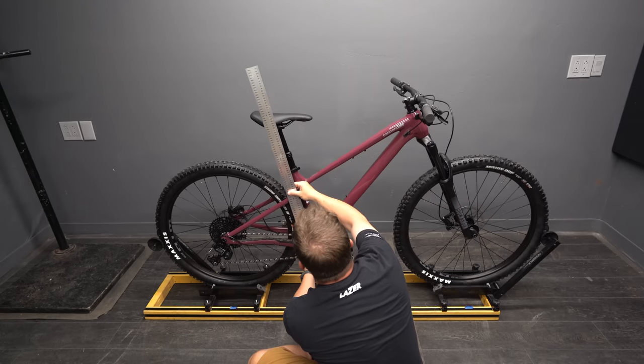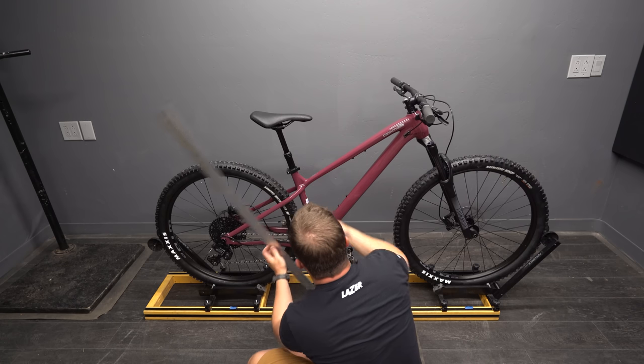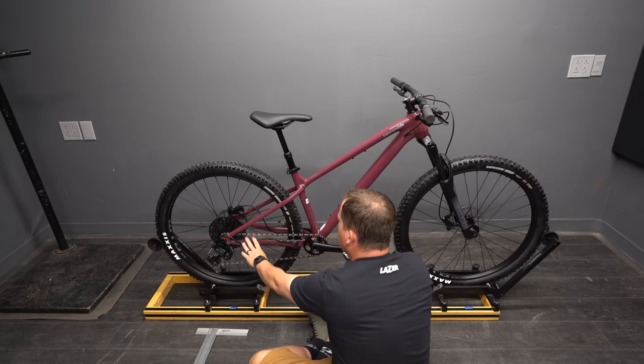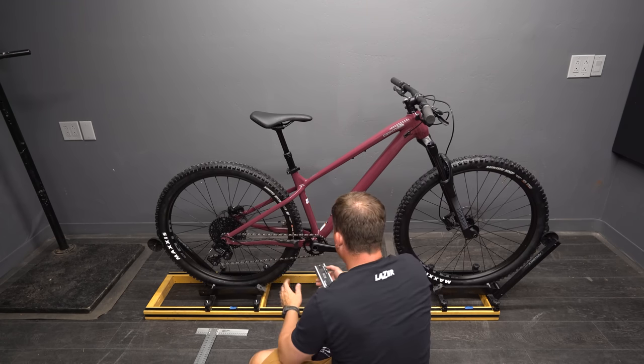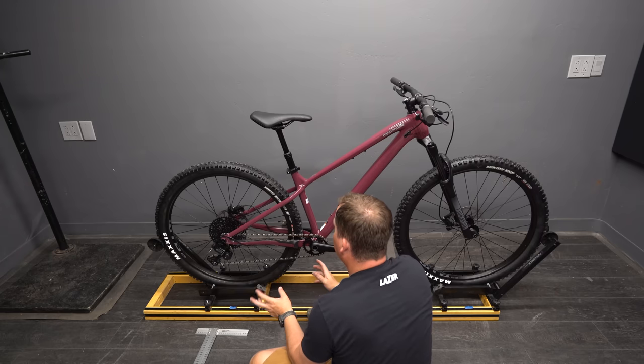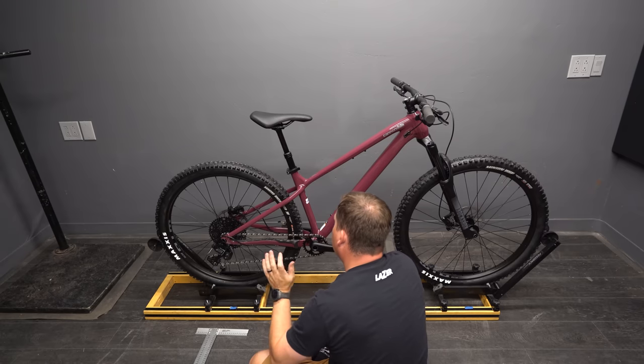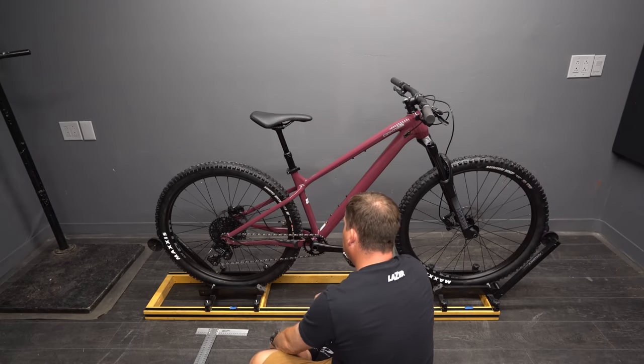We're gonna do effective seat tube here. 76.2. Good, I like that. Rear end's a little bit longer than what I typically like, but I think with the slightly shorter reach, it's actually gonna be a little bit more balanced, and it's gonna weight the front a little bit better so it doesn't wash out on corners. So could be really balanced.